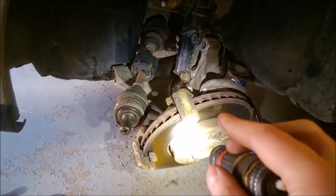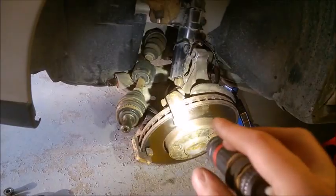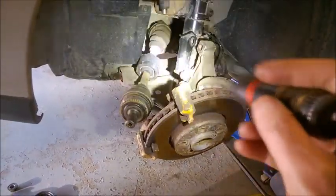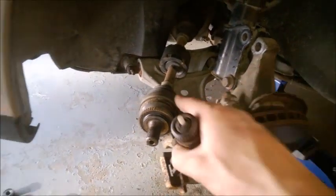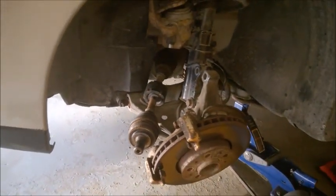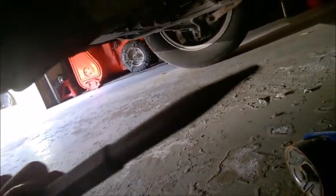It's really not worth fighting with a press. There are videos on YouTube, but if you put it on a press to remove the axle shaft from the hub, you will damage the wheel bearing — it's really not worth it. Just go ahead and replace the whole spindle with a second-hand one from a salvage shop and call it a day. The second area where it gets stuck really bad is coming out from the transmission — even main dealers cannot remove it sometimes.